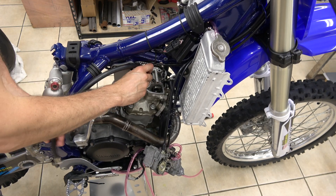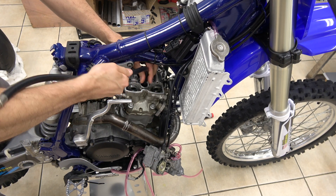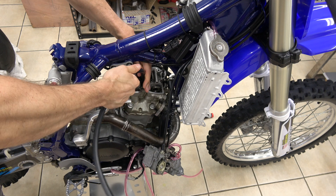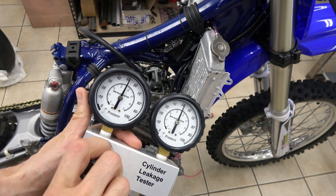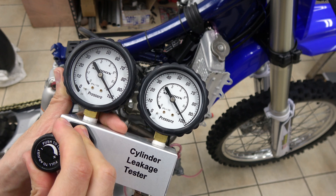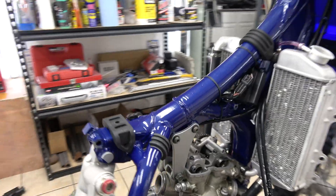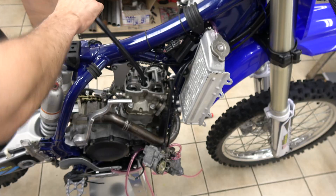Let's put the line into the spark plug hole and I'm going to tighten everything by hand — no tools. I'm using my left hand very delicately, trying to line up the line with the head because I don't want to cross-thread it. That would be a very expensive mistake. It's just going to be hand tight, not over tightened. I don't want to damage the o-ring, just want to seal it. I'm going to plug my tester onto the air compressor and turn my regulator to 100 psi input pressure. Before I plug the line into the engine I'm confirming we are at top dead center — the line on the rotor is aligned with the notch on the cover, and the lobes are pointing out with all valves closed. We're good to go.